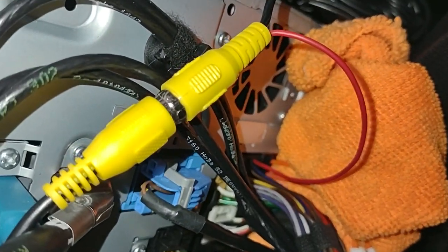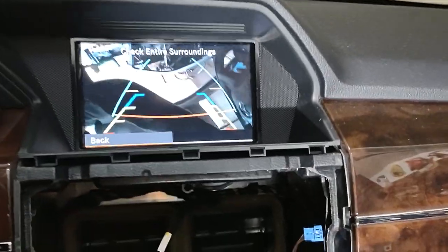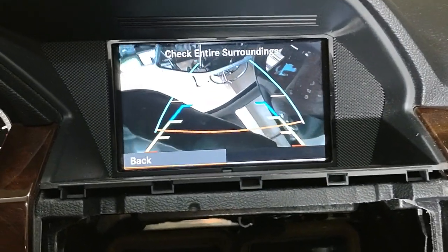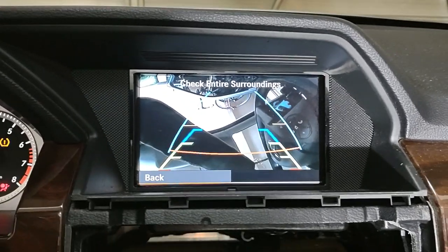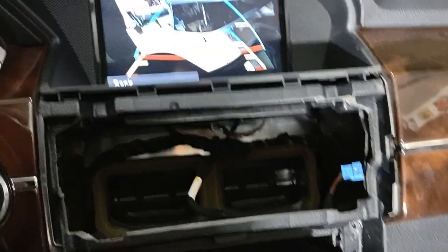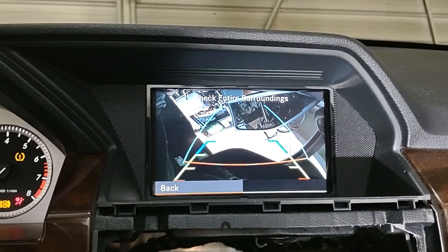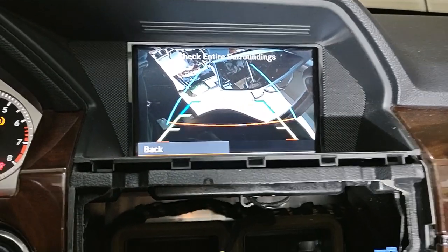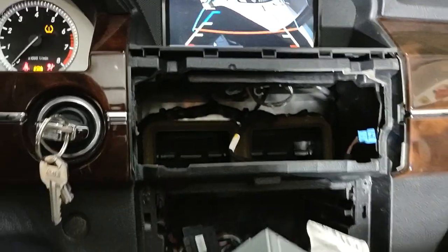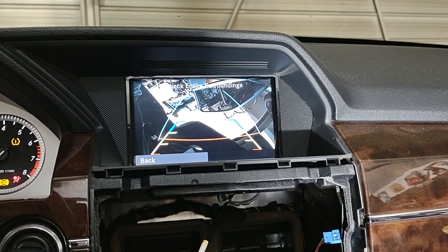It is obviously working. One surprise: we have two sets of lines. What that means is the Mercedes has helpfully inserted lines to add to your video signal — and the ad for this particular camera did not show that it provides its own lines, but obviously it does. That's not really a big deal. I can leave both of them on. I'll check it out at the end of the video and see if it makes sense to turn them on or off. But for now, we are operational and I know I can source that blue wire as my power switch to supply the camera.